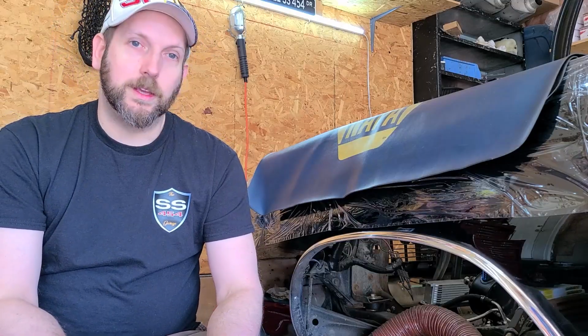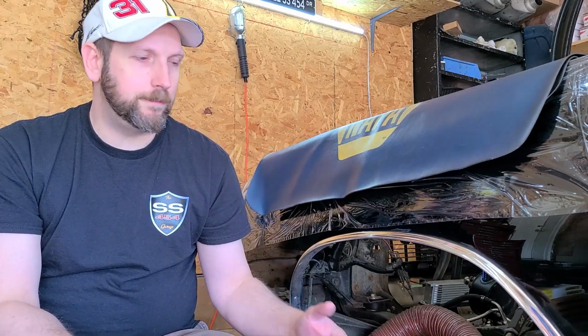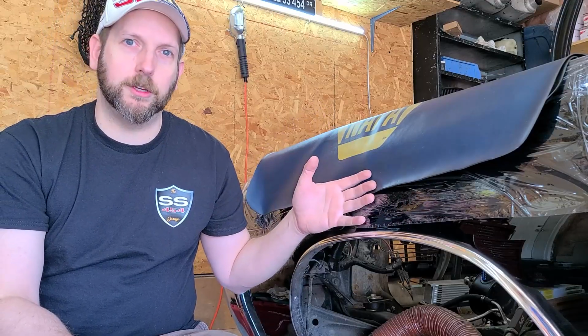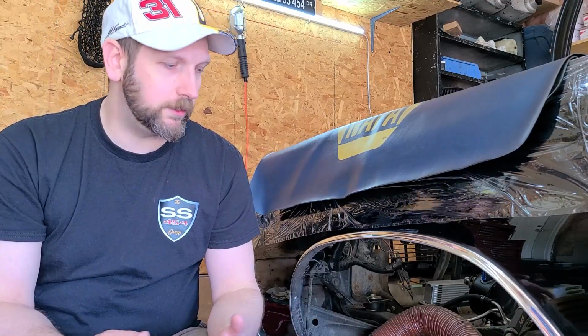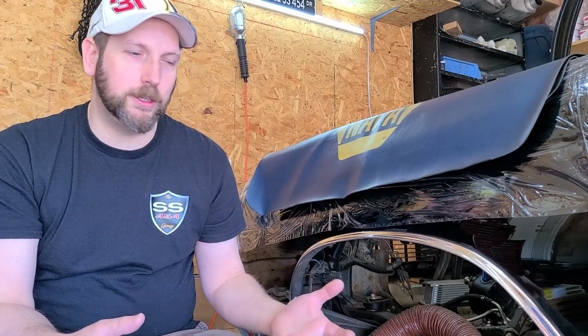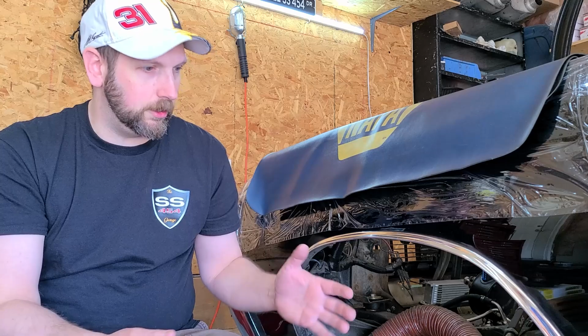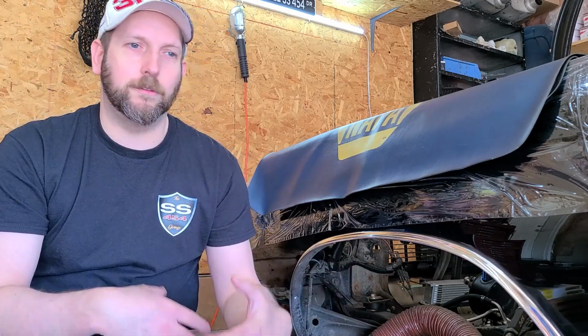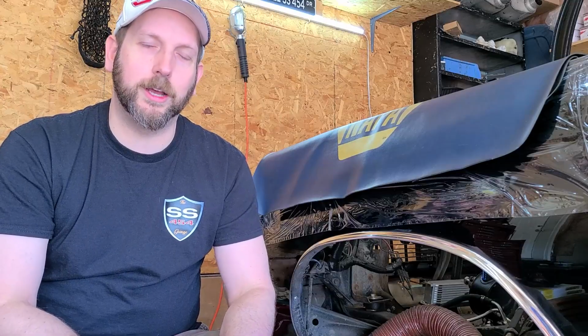The other reason, and this is a big one, ride height. Well, obviously, I am changing the weight of the front of my vehicle with the new engine because I'm going with aluminum heads. And naturally, if you change the weight, the ride height of your vehicle changes, and you might not like the appearance of it. So coilovers give you freedom to change the ride height with ease.